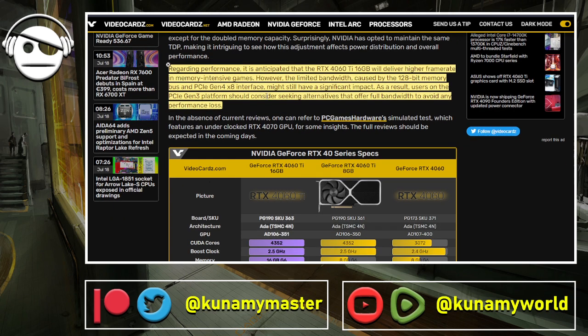it's a mess. Plus, with people with older motherboards, especially if they have PCI Gen 3, it's better to take older alternatives, because this will basically limit the performance of the GPU itself. Even if you can take advantage of 1080p gaming, the fact that it is limited to Gen 4 times 8 will limit it on PCI Gen 3 motherboards.